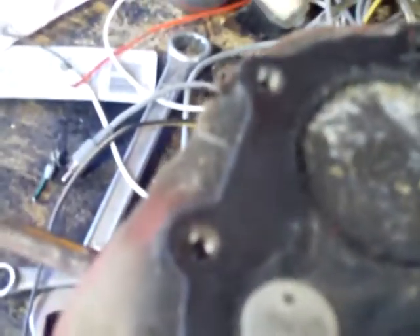The inspection plate wants to come off first — that has all the information of the engine. There's some kind of nest in there, maybe a hornet nest. There's the cylinder and it does move. The head gasket is stuck to the cylinder. There's some crud on top of that piston, so I guess it was a good idea I stripped this down. It actually looks like sawdust — this was sitting in an auto shop next to a woodworking shop for quite a long time.